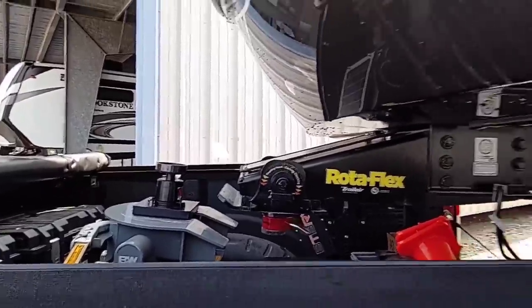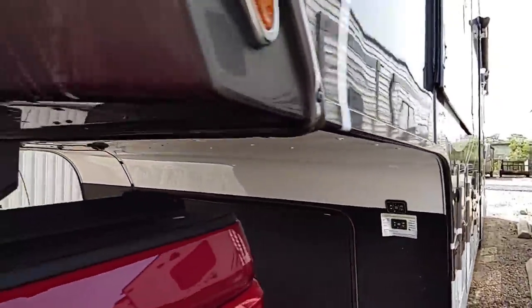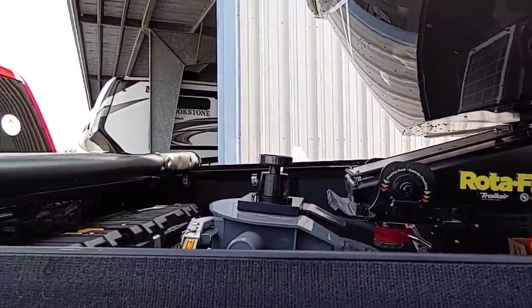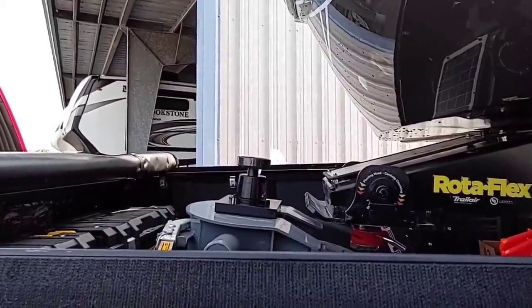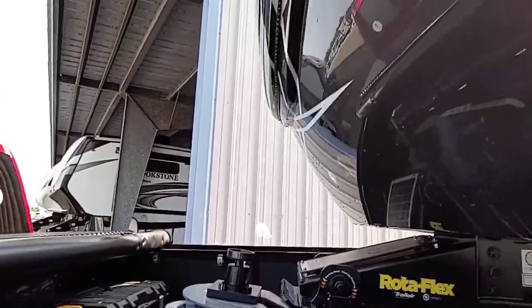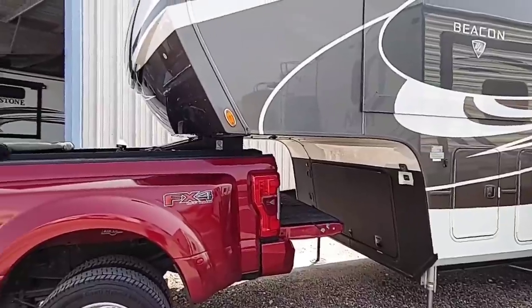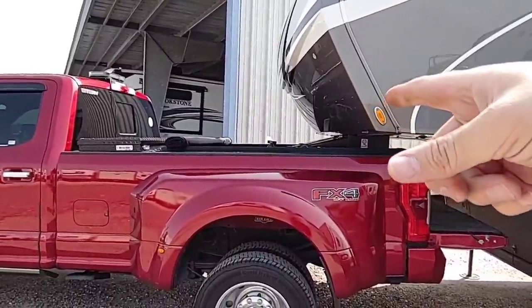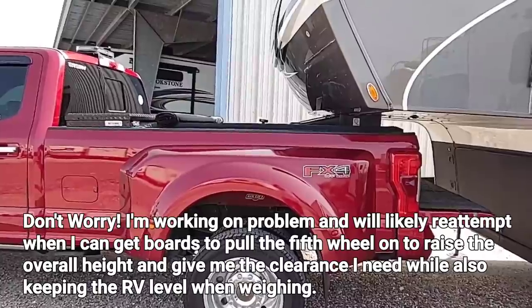It's too bad because I really wanted to see the actual pin weight of this specific fifth wheel, and their scale is just a bit too high. You've got to get higher than the scale and then bring it down and center it on top, which is something I really can't do right now. The normal hitch height is right about here — actually it's still too high. I have to drop this thing down significantly to the point where it would normally hitch up. Ideally, the best way to do this would be to make a stand for that scale that can position it at the correct height of your traditional fifth wheel hitch, and then lower it onto that — it'd have to be a pretty robust stand capable of holding upwards of 4,000-plus pounds.